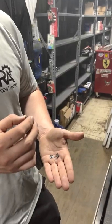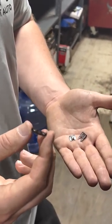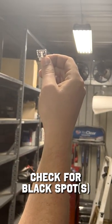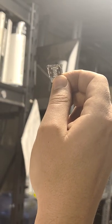So if I go ahead and show you this right here — this is a 2-amp fuse. This is going to be a very small circuit. You only see these in a couple of automotive applications related to computers. To check them, just hold it up to the light and make sure there's still a solid connection. A burnt out fuse is going to have a little black spot or a gap between the two terminal sides.